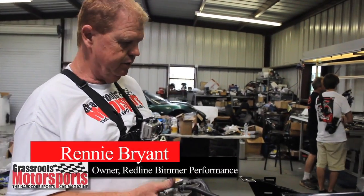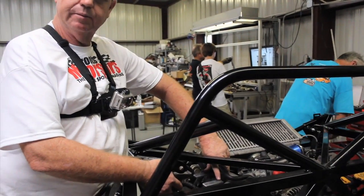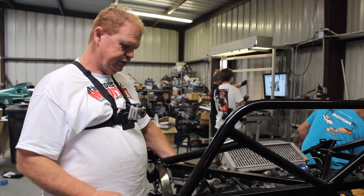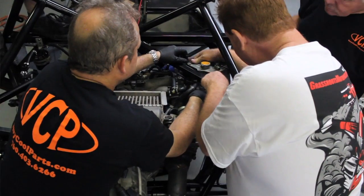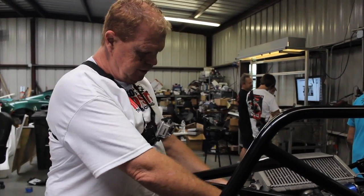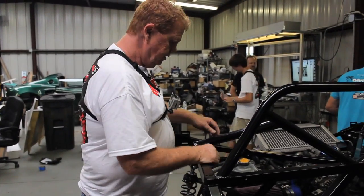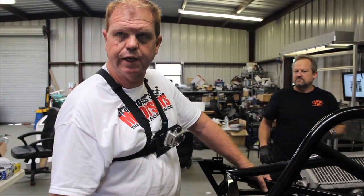We have the little expansion tank back here that runs the turbo cooler. Originally this was mounted right here on top of the manifold. Had we done that, that would be our radiator cap position. We said nah, that's a bad idea. So we just made a couple little aluminum brackets and it's going to sit in here just like this. It'll sit in there just like that so you can actually service it. We're going to block off one of these lines because we don't need it anymore, and the other one we're going to run through the expansion tank right on here, and that's all we've got to do.